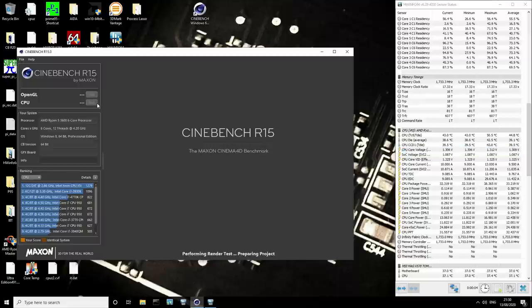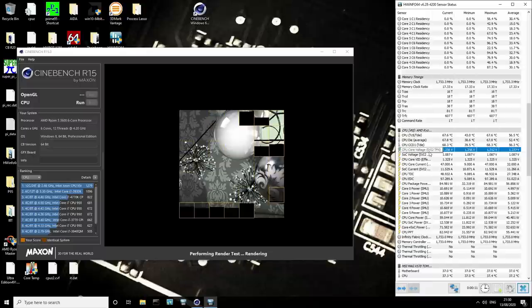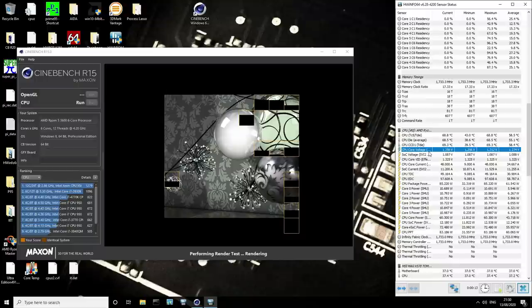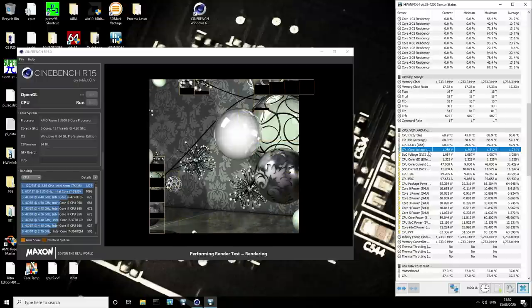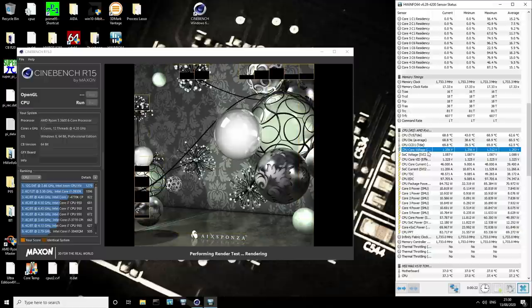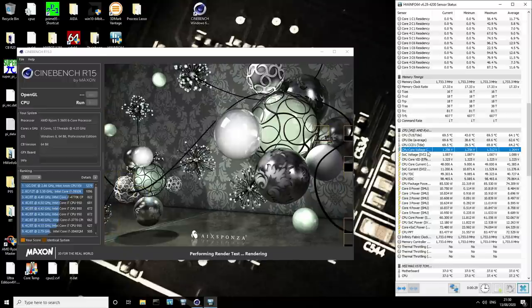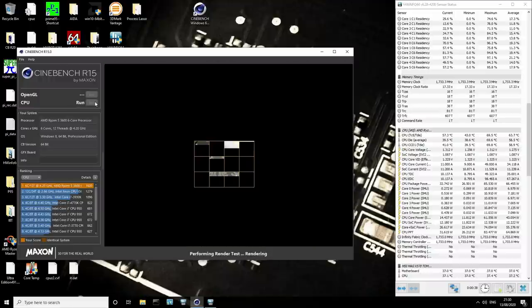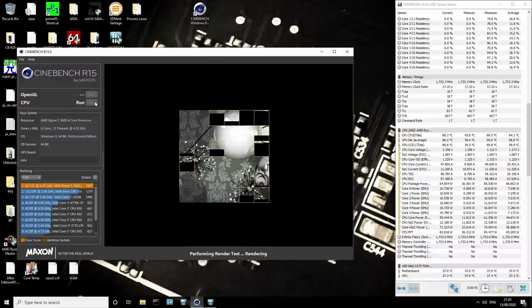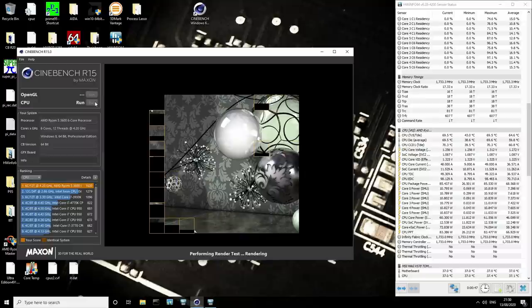Okay, so we're at 1.312. Okay, now I'm getting more droop than I was aiming for. Right, because now we're all the way down at 1.256 in Cinebench, whereas I was aiming for... Cinebench runs around 97 amps. Actually, no, that's not right. It's running 85 watts. So Prime95 runs over 100. So Prime95 is probably going to be hitting like 1.22, 1.23, maybe even less than that. So now I have way too much droop. I'm rerunning it because I wasn't happy that it spat out a 1620.